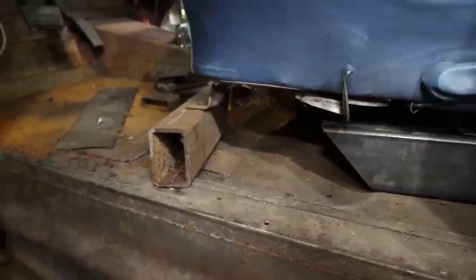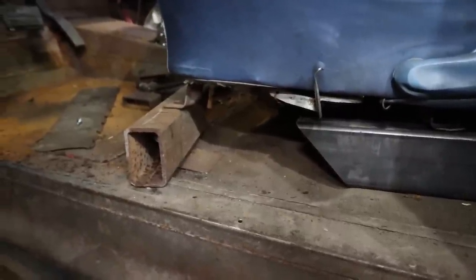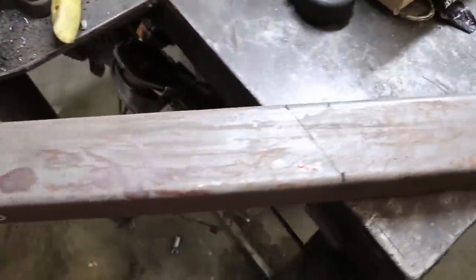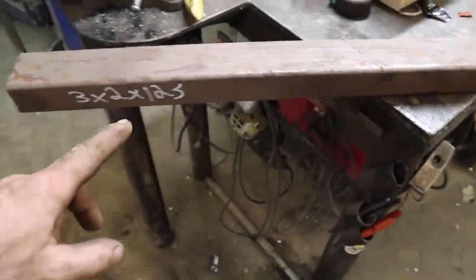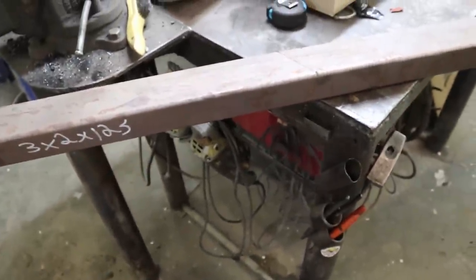So I'm working on the seat. Turns out a 2x3 is the right height. So I have some stock — what I'm going to do is make a complete rail. The rails are still under the seat, although I don't really know if he needs to adjust it. He seems fine when he's sitting in there. I'm just going to make one solid 2x3 going across so that I can burn it to the floor and then bolt the seat to it. Essentially I'm just going to cut that up. This is going to be the floor stock or the seat rail — I'm just going to do an angle cut, do another cut, then I've got both sides. I'll mark them, drill, tap them so I can bolt the seat down and call that part done.